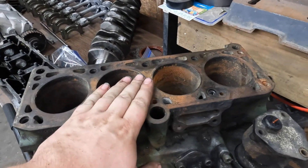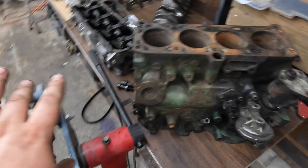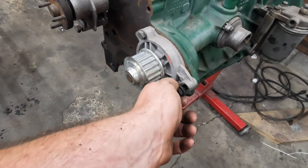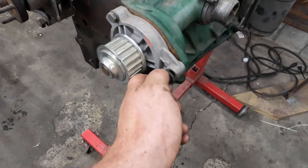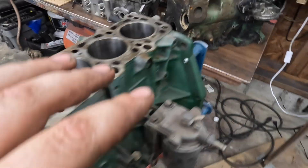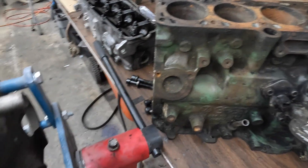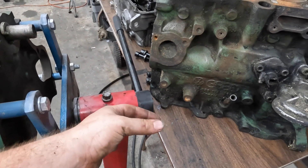I'm going to get this flipped around and we'll do some comparing between this and the 1.6. Clearly no secret as to why this thing is a boat anchor. These 1.6s are pretty bulletproof engines, but as we all know, six in a row is the way to go. So we'll begin with the cooling system. The D24 has this goofy water pump tensioner assembly, which I guess works great from the factory. But pitting will become an issue because when you have that O-ring sitting in the same spot for 30 years and then you go to move it, you're going to get a leak. Over here we have the external water pump driven by the accessory belts on the 1.6. Furthermore, the thermostat housing on the D24 is right on the side of the block; on the 1.6 it'll be hanging off the side.